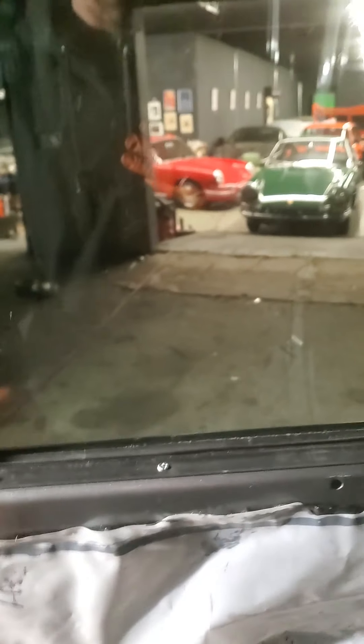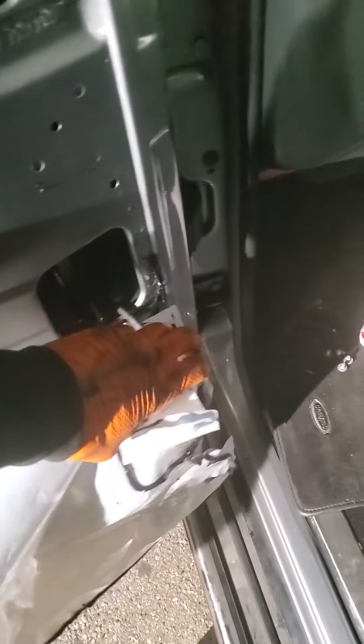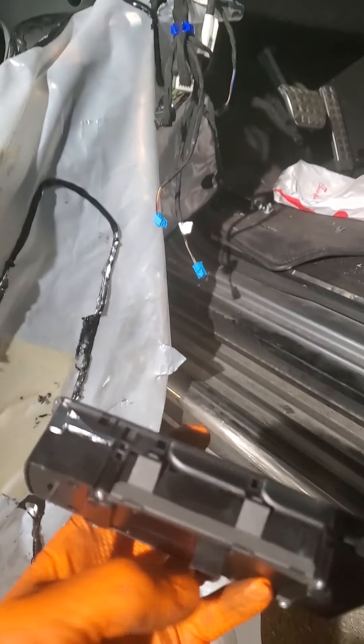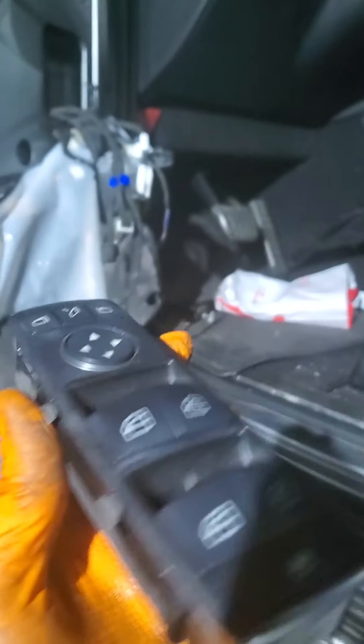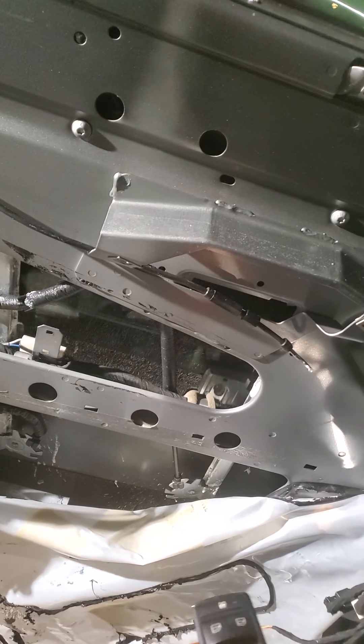Then what you're going to want to do is remove the glass, the frame around the glass, which means also all of this and the regulator. So first pull this off, pull the wires back, and this exposes your window regulator. Take your door switch off - it's easy. It's in the door panel with these little tabs, so you'll reach from the bottom side and press these in and push up and it will come right out. Then you can plug this in and roll it down until we can access these two bolts here.